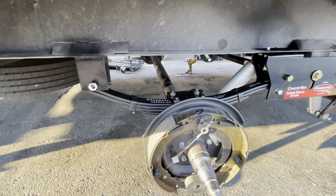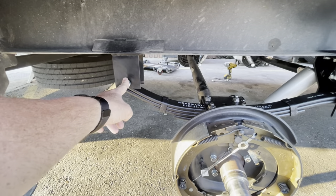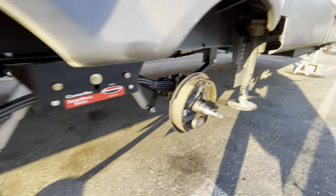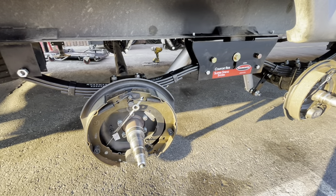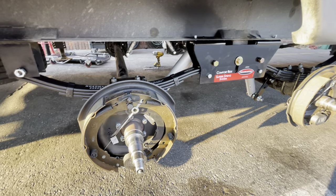We get as clean as possible. On the Roadmaster Slipper Spring set, the only maintenance is really we put a wet bolt in back here in the rear hanger, and we put a wet bolt in in the front hanger. Literally all you have to do from this point forward is lube those four grease bolts that we add. They don't typically come with wet bolts in the back and the front, but we add them as just an additional safety feature.